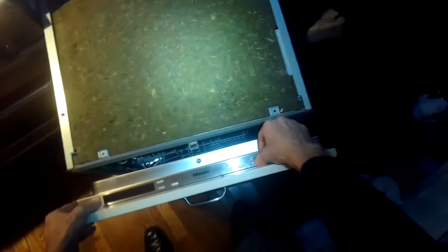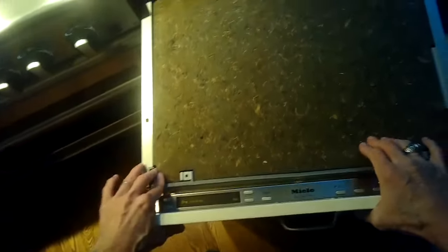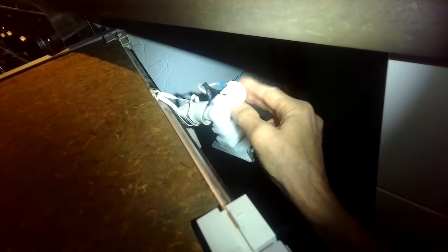When a fill valve stops working, it either doesn't let enough water come in, doesn't let any water come in, or it leaks a little bit — it doesn't close all the way and lets a tiny bit of water continue to come in even when the dishwasher is unplugged, which I think is what was happening on this dishwasher. We've replaced the fill valve with this aftermarket one — I'll put a link in the description, these are only about $25. We've got it strapped back into position and we're going to test it to see how high the water gets after doing a cycle.